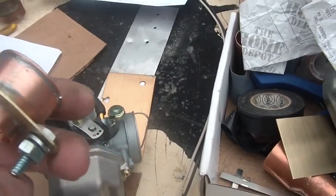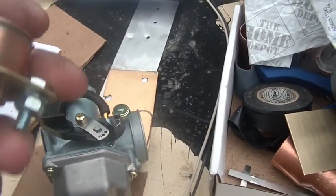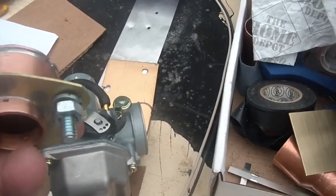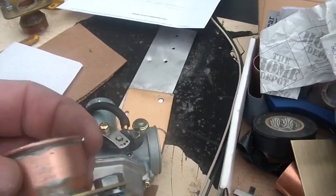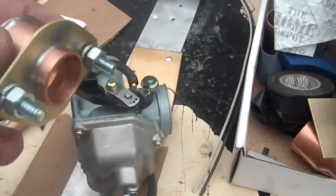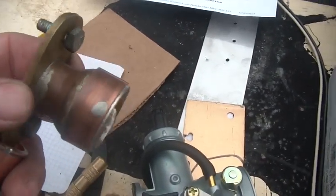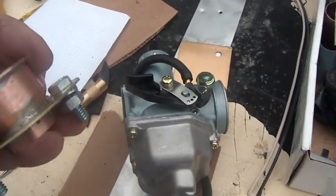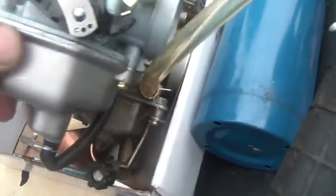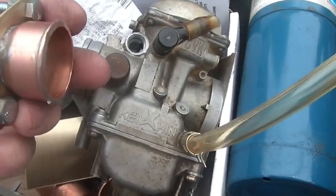So it's off and the new one's going on. The way the adapter goes onto the motor, there's a cutout area — you slide it on and it seats into a ridge on the motor, then you clamp down the outside, so it won't be falling off like the old one was. I think this one will go on and stay on good. This carburetor is a tad shorter, but with the adapter it's maybe a half an inch longer overall.